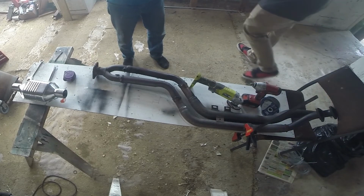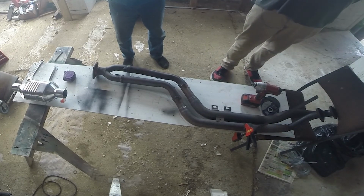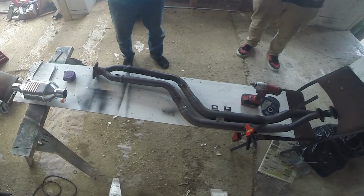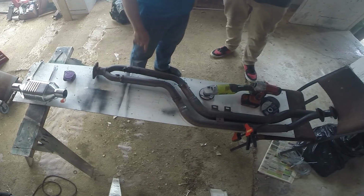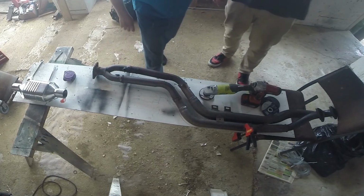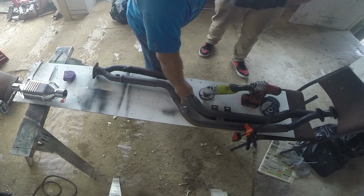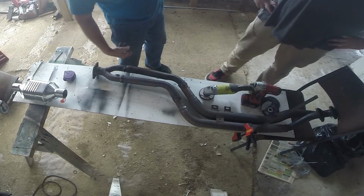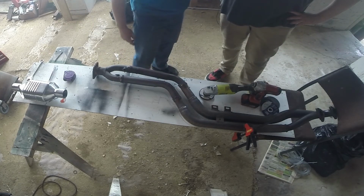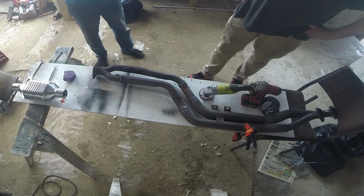Now what I'd like to do, grab a cup of tea, see if we can't find this exhaust system online. Because I'm looking at this thing here, you see where this has been chopped around here. I would like to know what that cat actually looked like. Because there's something odd about this. See the way they're sort of staggered a bit? They may well be welded in. But if you flip those over, they fit into that. They're staggered the other way too. But that then means these are before the cat, and they're pointing at the ground.